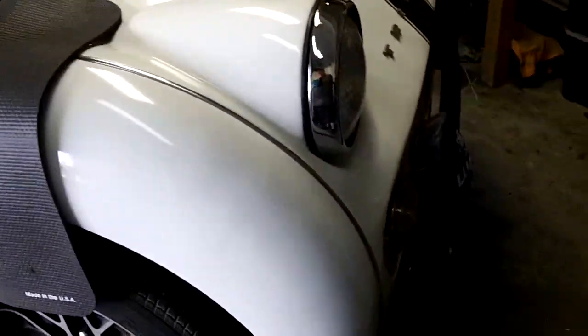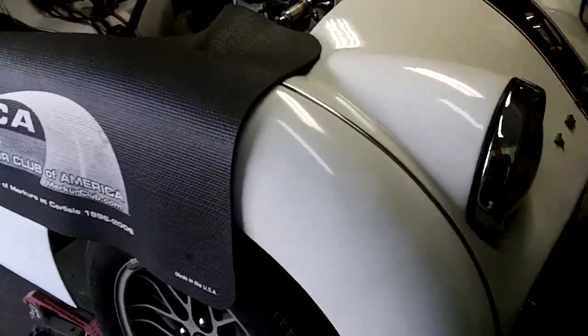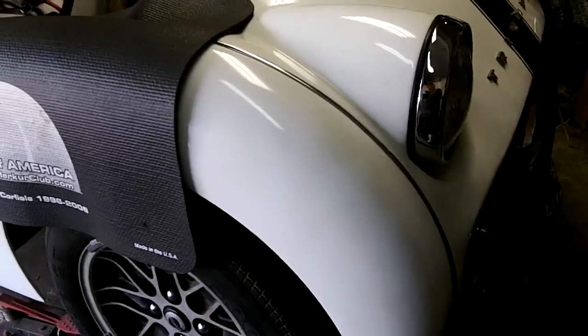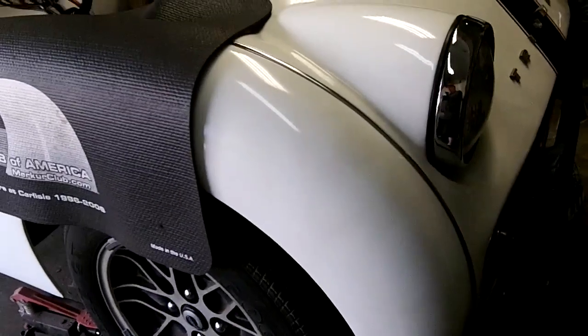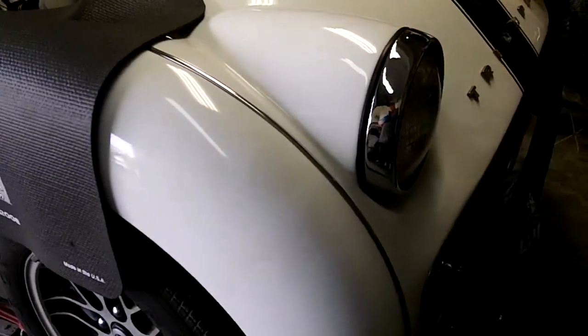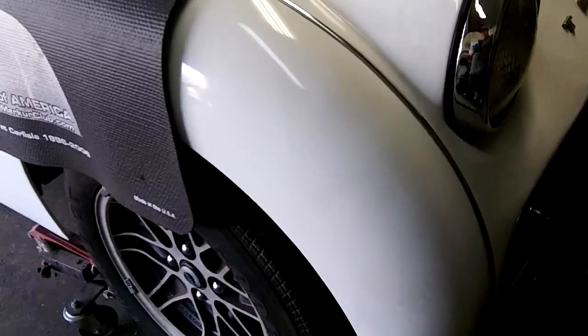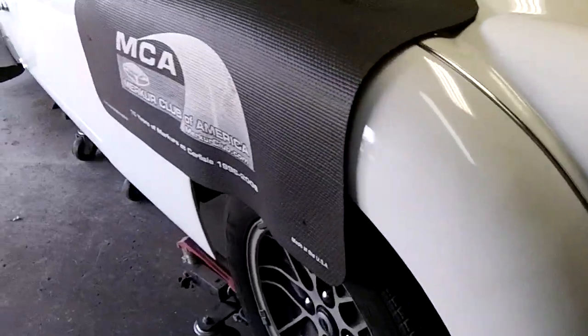Taking the front fenders off would obviously entail removing the front bumper, so I think that's what we're going to do today — take the front bumper off and take the front fenders off. We're going to start getting them prepped for repainting, which will require them to be cleaned first rather well with wax and grease remover, dish soap, Windex, and alcohol — you name it — before I even bother to start sanding. I don't want to sand any of that stuff into the paint surface; it's a bitch to get out afterwards. I learned that sort of the hard way when I went to repaint the hood. First step will be to clean and degrease these really well before we sand those down to 600 grit wet for repainting.